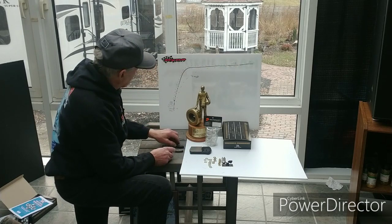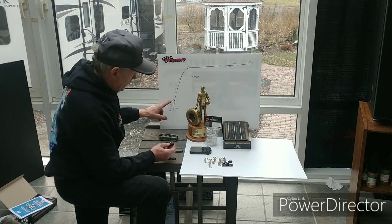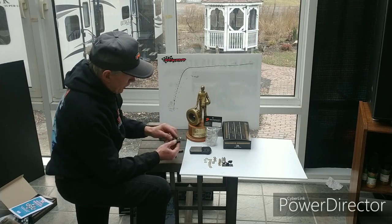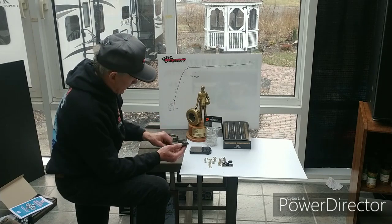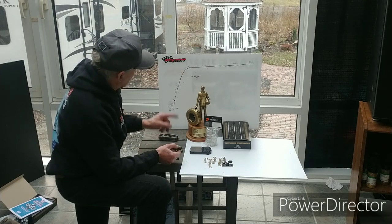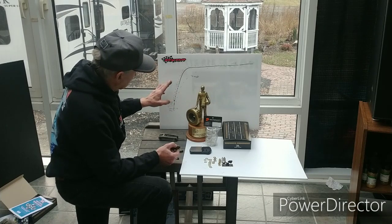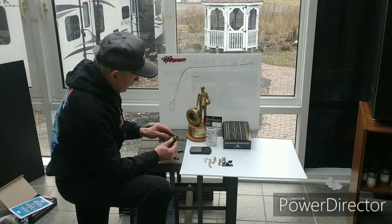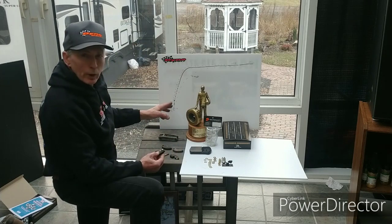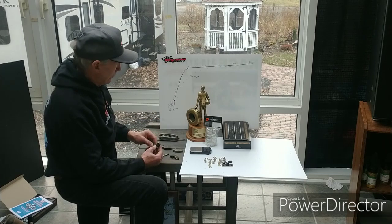What I found today: because my engagement went up so high — I was at 4,200 to 4,300 — I just simply reversed it. I put a little more weight on the tip, went back into the field, and now I ran like the stock, which was engineered very well. Since I had just a hair less tip weight, I was about 100 RPMs higher, which means when I stud my sled, I'm going to be perfect.